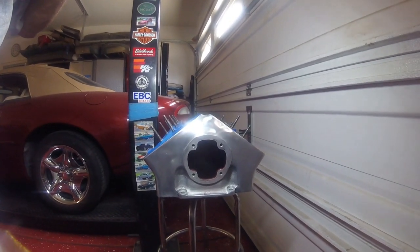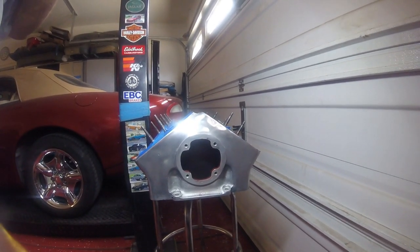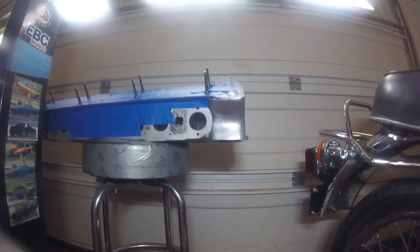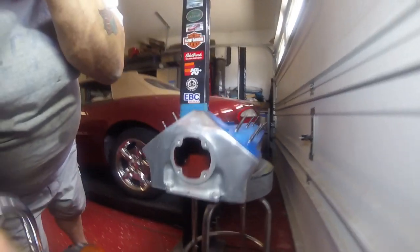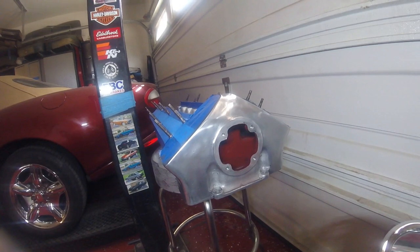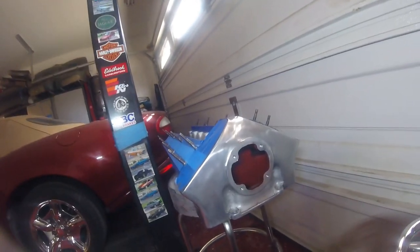Here it is — this is as far as I'm going to go with it. I have polished it up, not super chromey as I've mentioned, and I've now given it a quick coat of clear lacquer. That is how it is going to be. So hopefully you can see it looks quite nice — not perfection, 1964 as I've said before. Next, once that's dried, I will then mask it up ready for painting. But that probably won't be for a couple of days, because I want to make sure that the lacquer is completely dry before I stick tape on it.